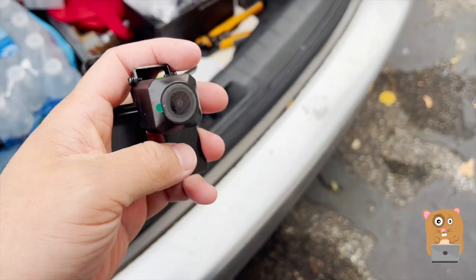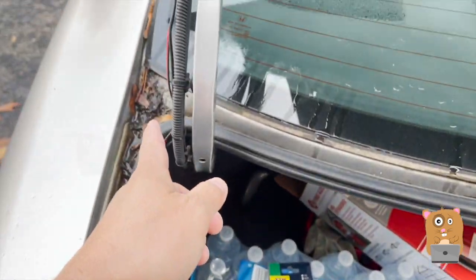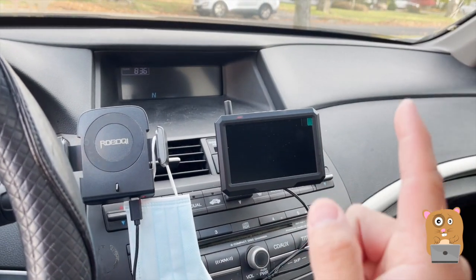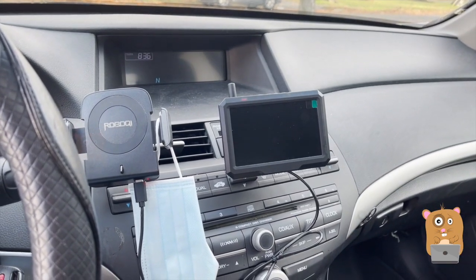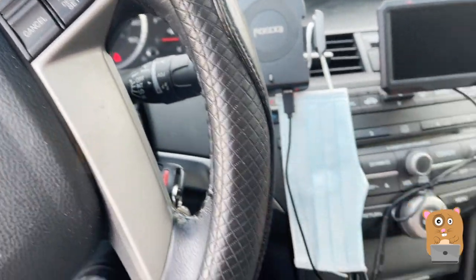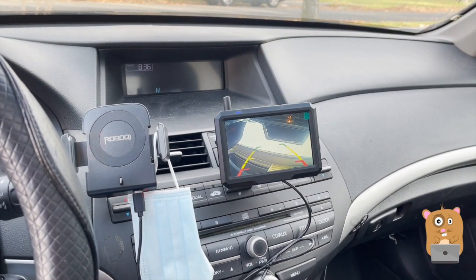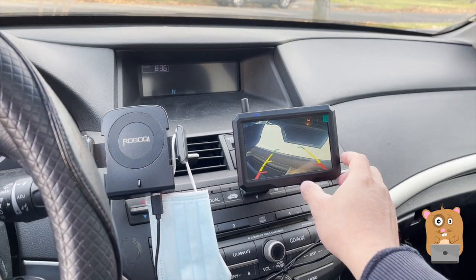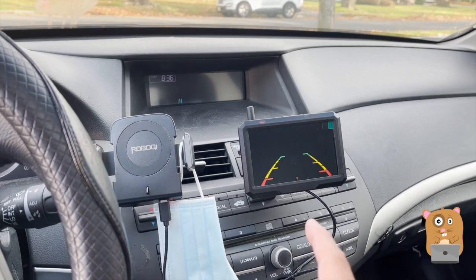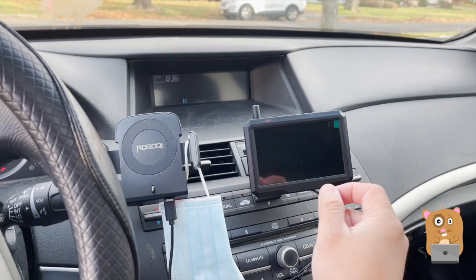I think ideally the camera will be at the license plate level, but it doesn't have to be. If it needs to be at the license plate level, then I need to run the wires all the way through the top over here. Another piece of advice from past experience: before securing it to a certain location, test it first. Make sure that power is successful — the car does not need to be running, it just needs to be in the on position. Pull out the handbrake, put the car in reverse, and make sure power is running to it. Looks pretty clear. Now I can move the camera to where I want, knowing the power situation is all taken care of. Once I mount it where I want it, test the power again.